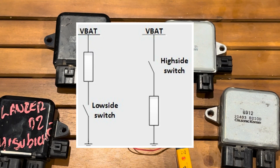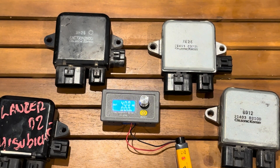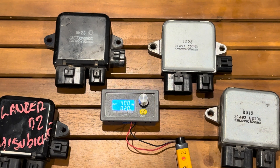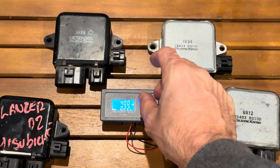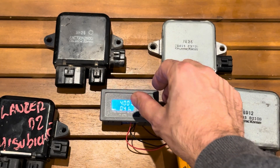These units work with both high-side and low-side switching depending on your setup. Most aftermarket ECUs are low-side switching, while this Amazon controller is high-side switching, so the pulse width response is completely different. With low-side switching, the ground on the ECU is what turns on and off. With high-side switching, the pulse width range for these fan controllers is between 0 and about 20% where the fan stays off. Once you get to 21-22%, the fan starts to turn on at low speed, and the closer to 100% the higher the fan speed.